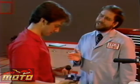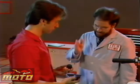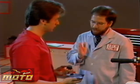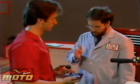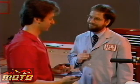Bolt the adapter in your left hand in place of the carburetor, blocking off the intake tract. Then attach the adapter in your right hand in place of the exhaust manifold gasket, blocking off the exhaust port. When those are sealed, we'll be ready to test crankcase pressure and vacuum.